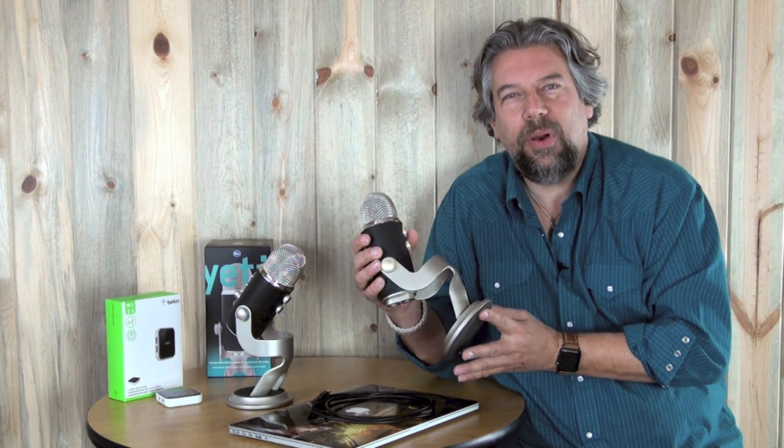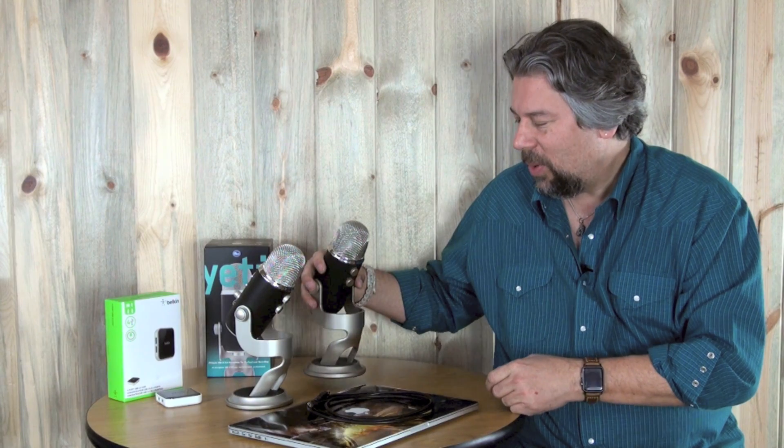What's happened is that if you have an older Yeti Pro microphone, you've probably noticed that like some other USB 2 devices, when you plug it into your iMac or MacBook Pro or any device running El Capitan that has a USB 3 port, it doesn't actually talk properly to the USB 2 device anymore. The characteristic I saw with my old Yeti Pro was that I'd plug it in, it would see the microphone, then the microphone would go away, then it would see it again, then go away — it became unusable.